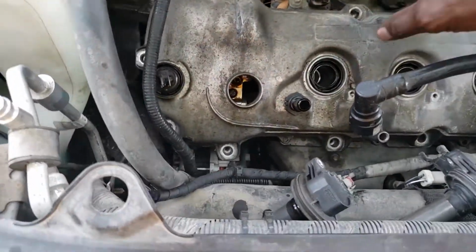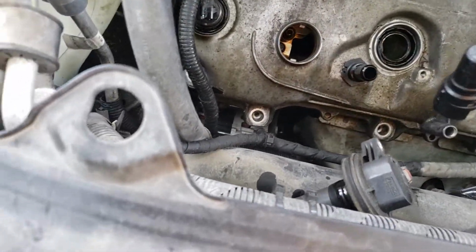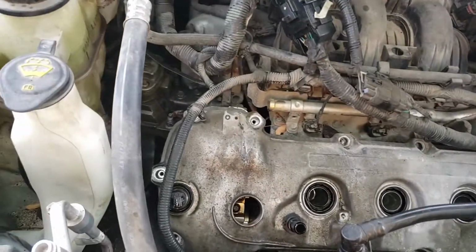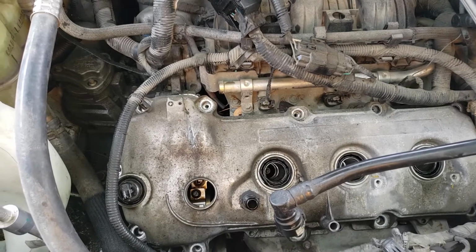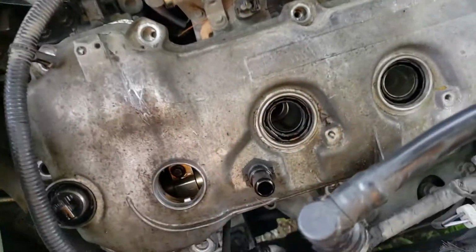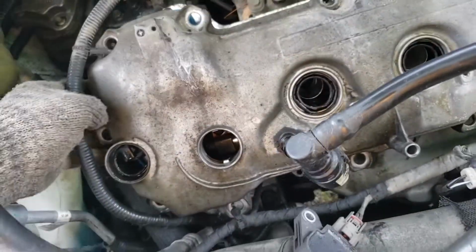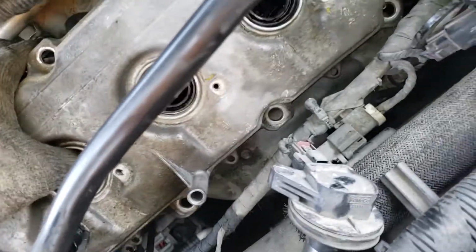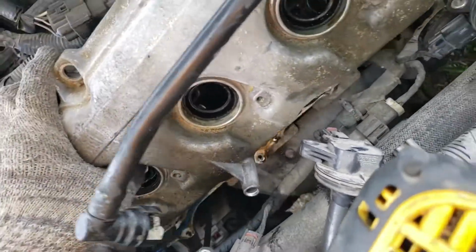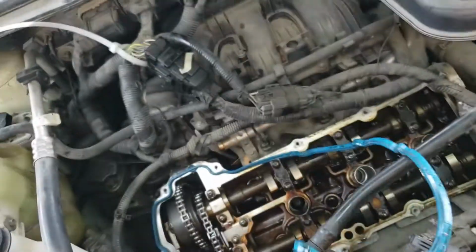Okay. So, gasket comes straight up. You might have to nudge this a little bit. I'll show you this when it's done. So if you reach back here and you just pull up, you can get the cover off. And you can see the gasket there coming off of the cover. You slide this right out. And there's nothing holding onto it. And that comes right off. And there's the gasket there.